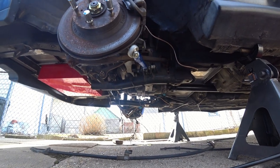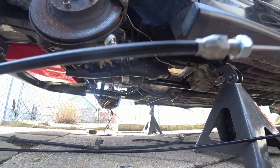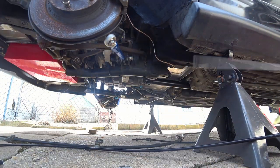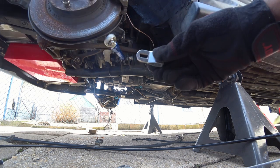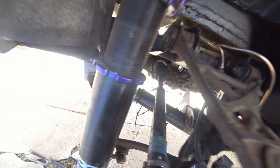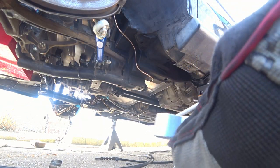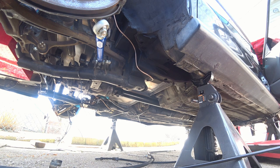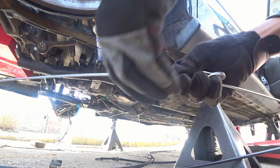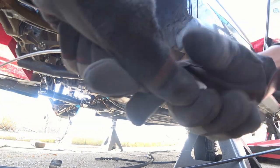So this is how this cable works: basically remove this section from the shield. This is the bracket that will attach to the actual e-brake. What you do is this bracket will fit onto the old clevis right there, and you just basically feed this line through it.